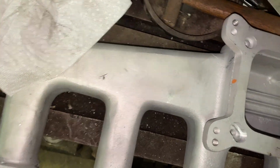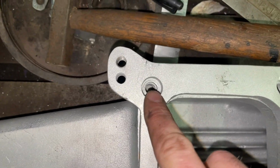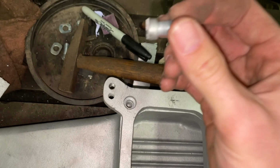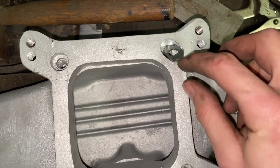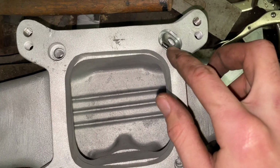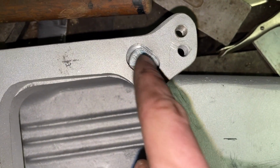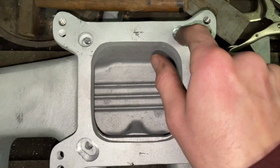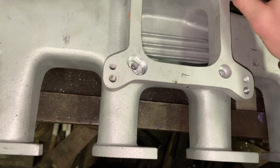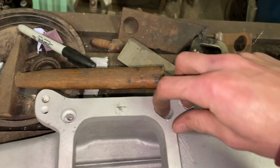And then because these heads aren't very big on these, and that's a pretty big slot, it's the same size hole as that, but now it's elongated, so you have less clamping surface. So I took these 5/16 flat washers and ground them flat, and now I can drop these down in there, and the hole lines up. That one has to be flipped because I actually rounded it. But anyway, the hole will line up, and I maintain the same amount of clamping surface. And I did already check that the head will not protrude past the surface, so I don't have to do any clearancing on that or anything. But that's my solution,